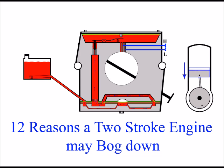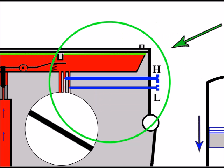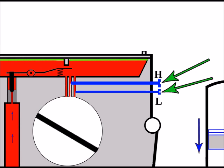So as soon as I hear this, I realise there are many reasons for the cause, but the first thing I do before I do anything else is check the mixture screws. Therefore, the mixture screws are my number one. I'll check these before I check anything else. This is the high and low screws, the fuel air mixture screws on the side of the carburetor. The H of course means high, for the engine's high speed adjustments,